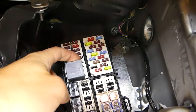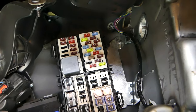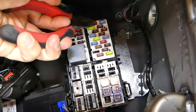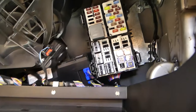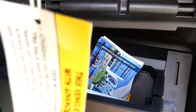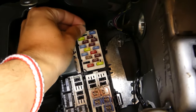Fuse number 24 is the one right above the relay — we don't have that one because we have the navigation model. Fuse number 10 is supposed to be a 15-amp fuse. We have a 10-amp fuse installed just to demonstrate how it doesn't work with a blown fuse. This is the blown fuse right here — it's supposed to be 15 amp.